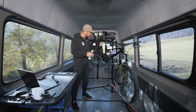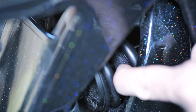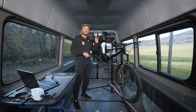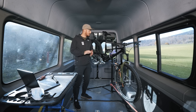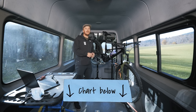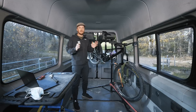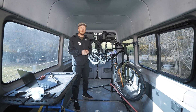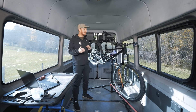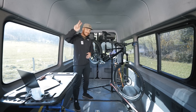To set up the sag on the coil shock, you'll use a bumper instead of an o-ring. As a baseline: a higher spring rate decreases sag, and a lower spring rate increases sag — as simple as that. To check precisely what spring rate is needed for your bike, please check the chart below where we have the spring rate defined for your weight. Make sure once you have your setup dialed to ride it down, and in case there are any changes, you can always go back and refer to it. Cheers and enjoy the ride.